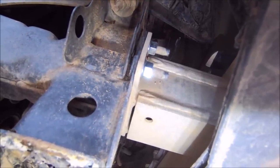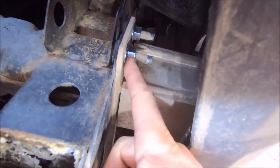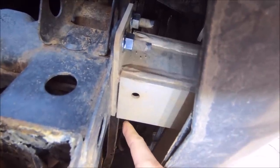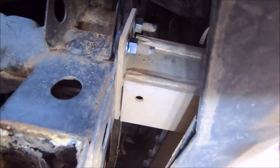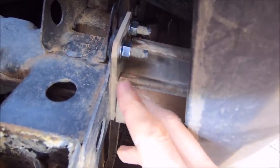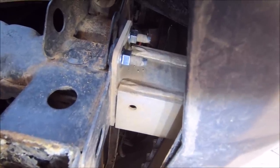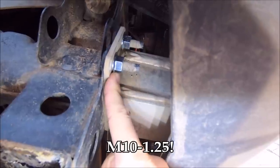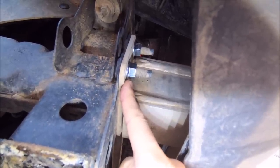My buddy Eat Sleep Tacos was looking around under my truck and noticed here on the aluminum crash bar there are two flange nuts on the passenger side — same on the other side — and one on the inside. He noticed I had the factory flange bolt on one side but was missing these two for some reason. I haven't had any body work done, and I'm wondering if it came from the factory like this, because there was no stain ring like you'd see if nuts had been on there for a while. I was able to find M12 by 1.25 flange nuts at Home Depot or Lowe's. Got a few packs just to replace everything — curious if any of you guys have these missing from the factory too.